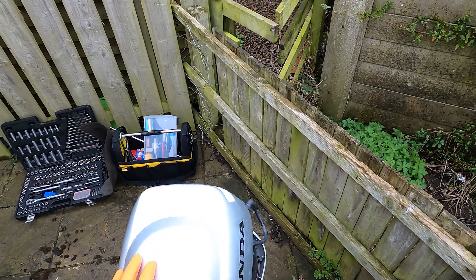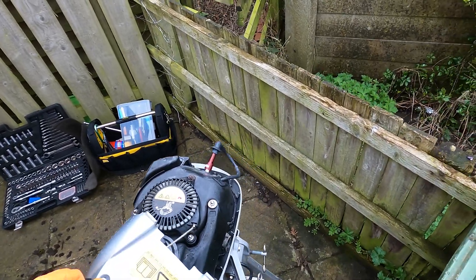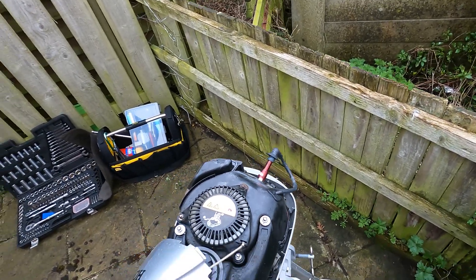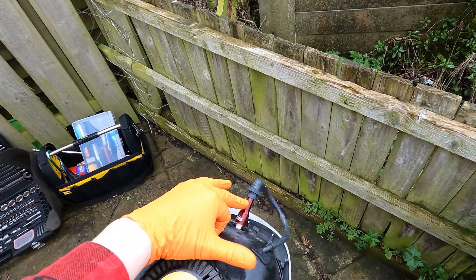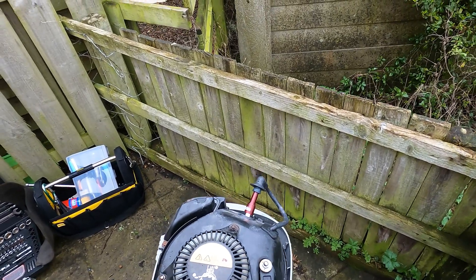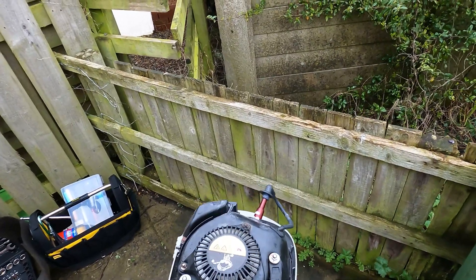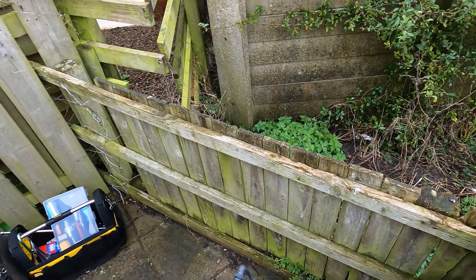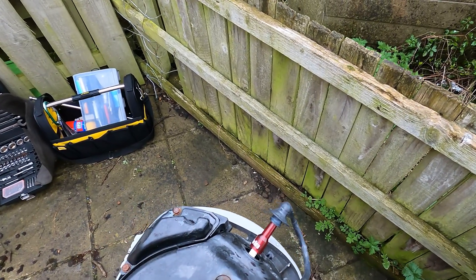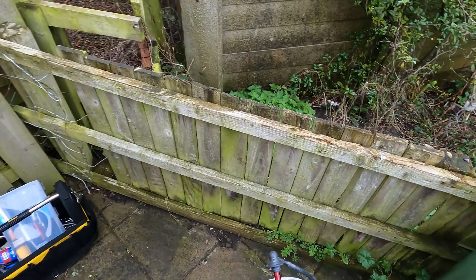The recoil handle is part of the cowl, so it's a little bit awkward to get it aligned. We also don't have the kill cord — it didn't get dropped off by the customer. But I can pull that out, brace the engine, and just give it a pull. I'm looking for a bright flash here. Yeah, you can see a spark there. So we're getting flashes. That indicates to me that the kill switch is working, the HT lead's working, the coil's working, and the spark plug's working. We've basically eliminated the ignition side.